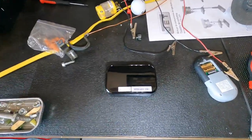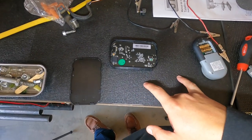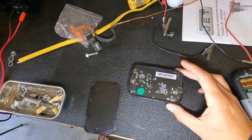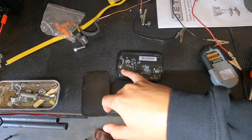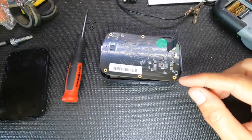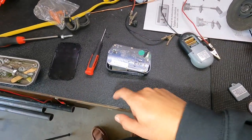Now I know on older iPhones — not the brand new one — it switches automatically between the two bands, so some people use their regular iPhones and it connects fine. But I'm not going to let this WiFi issue go, so I've pulled the device over to the workbench and ripped it open. I'm going to try to make it easy for people who have already purchased it and want to connect to the Ram. We really just need to swap out the Wi-Fi module to one that picks up both 2.4 and 5 GHz. I've found the wireless card — the Bluetooth side is here and the wireless side is here — I just need to do a little more homework to figure out what we can do.